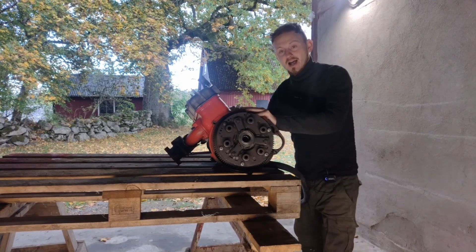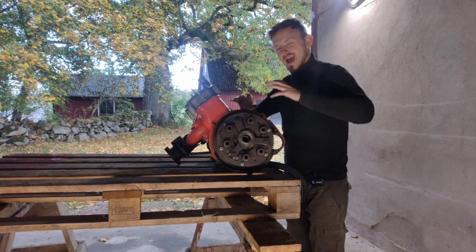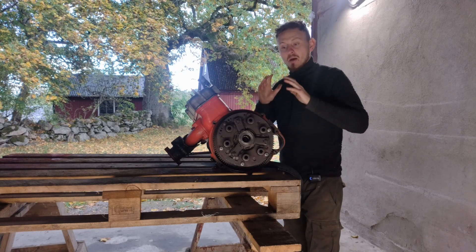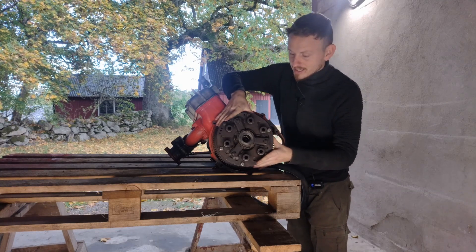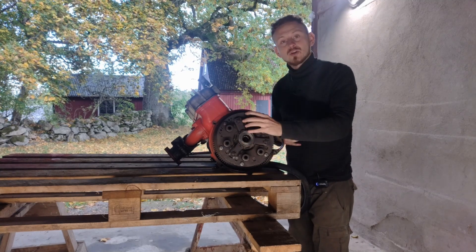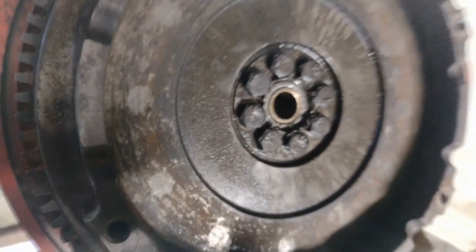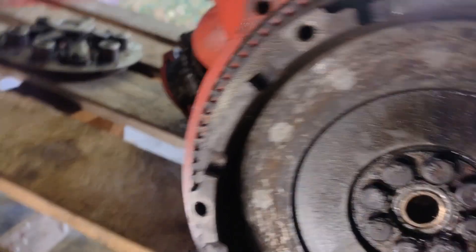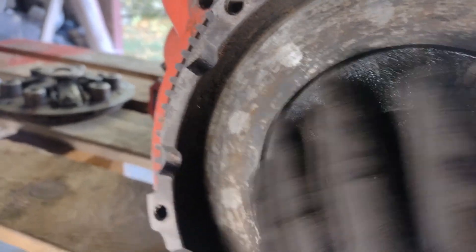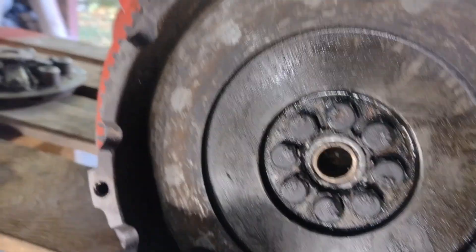The engine is out of the vehicle. Some of the times I tested this engine it had a clunk clunk clunk sound, and I thought it could be the bearings inside the engine. But to my big relief, I found out it's actually the clutch plate right here that is loose. I'm gonna take this apart and see what's going on underneath. I think I've done it the right way - these small plates here are all wound out so it won't get loose again, and now there is no rumbling whatsoever.